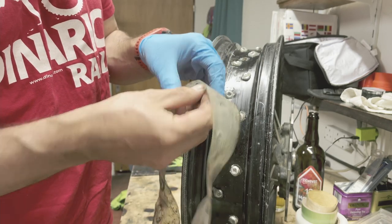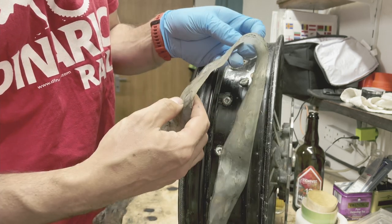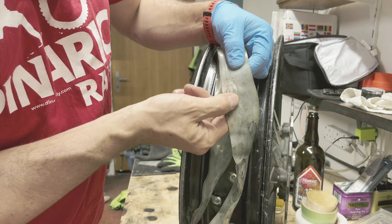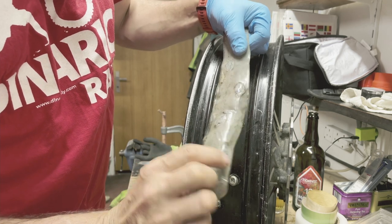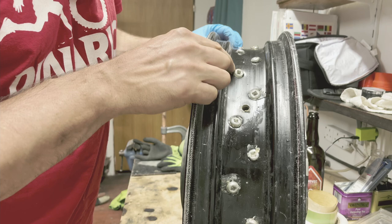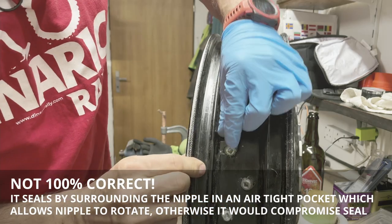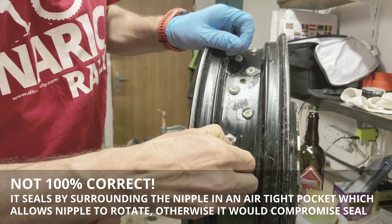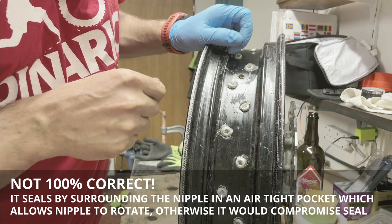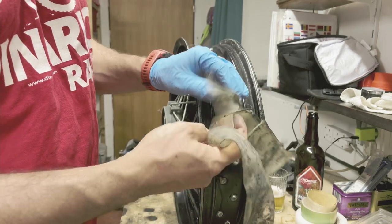The Altex completely lost its stickiness. The white one is the protective layer — this one should be sticky as hell, and there's basically nothing. You can also see that the holes are quite long. The Altex is still left on the nipples. This is how it seals: it gets pushed by air pressure into the spokes and nipples, and that's why it doesn't leak. Not a cool outcome after 20,000 kilometers.